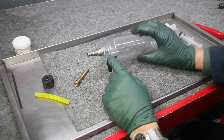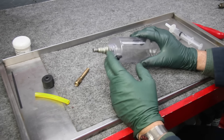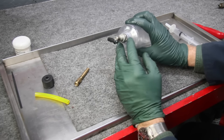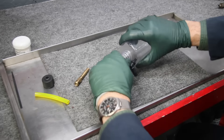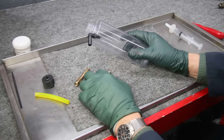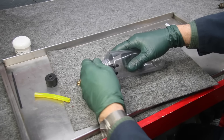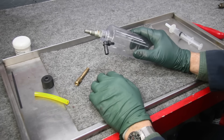I won't be able to get it all the way down inside the bottle, nor will I be able to tighten down the cap for a complete seal to contain any fumes. You could take some tape and wrap around that area to tighten it up if you're doing a lot of back flush cleaning. What I'm going to do is use the same bottle for the test and cleaning procedure — I'll just trim that edge back and force the injector down in there.